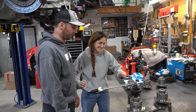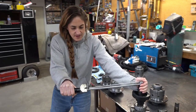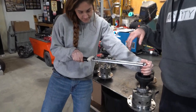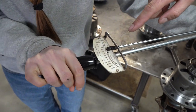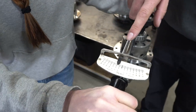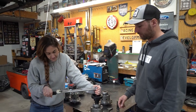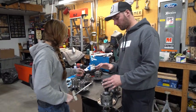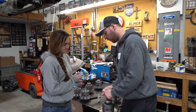The first pull was kind of rough — about 45 to 50 foot-pounds. Now coming forward again, you'll see it goes up about 35 to 40 and then breaks away, holding about 30 foot-pounds. That's both directions — it doesn't make a difference. This is the one we had set up. We typically set ours around 25 to 45 foot-pounds — that's the number we're looking for.